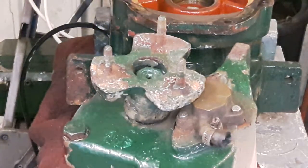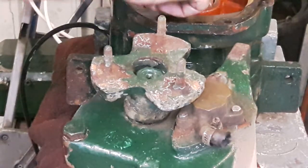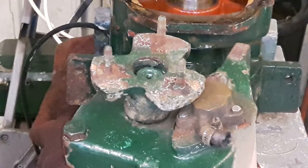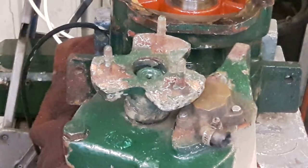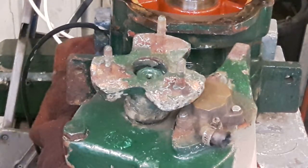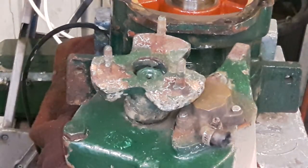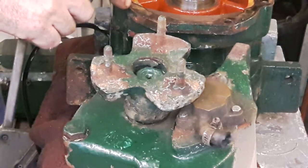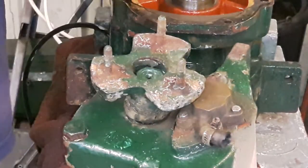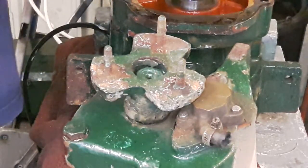When you're doing your first fit, I'd suggest that you put your shims back in as they were, because there's a good chance that there won't be much difference in the thrusts. Then measure it. If it's too tight, you're going to have to take some out. You need to put the gasket in, and the gasket should be the same thickness — it's about 25 mil thick. I supply new gaskets with my gearboxes. Just tighten two opposing screws down to medium torque and you should have enough to test it. You don't need to get all the bolts in to test the free movement — just a couple will do if they're tight. I'd suggest you don't put gasket sealant on this the first time, just maybe the bottom side. When you're finally happy, you can take the two bolts out, tap it apart, checking the pump shaft comes out nicely, and then put gasket sealant — Hylomar — on the perimeter the last time, then sink all of the bolts in.